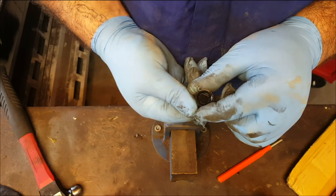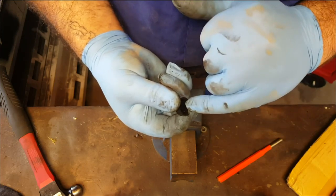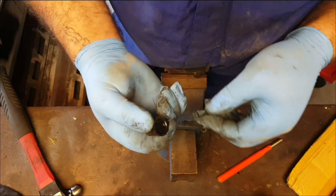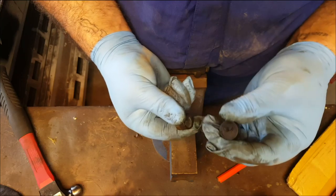This is a really old school style wheel cylinder. They're not normally like this anymore. They normally have a hole in the middle of the seal, and they have a little button on the end of the piston, and you actually fit the seal onto the end of the piston and it's positively fitted. Sure, there is still a light spring, but the spring's job isn't to hold this in place.